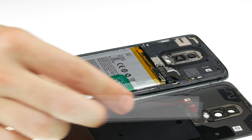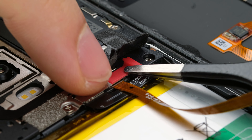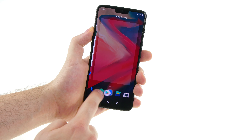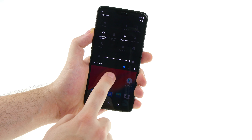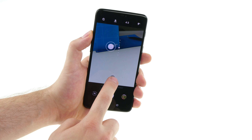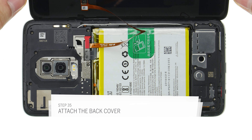Place the back cover next to the device. Position the cable of the fingerprint sensor over its contact on the main board and connect it. Place the cover with the red rubber piece and re-glue the black tape. Before closing the device, you should test it. Turn on the device and check the screen first. Slide an app along the edge and zigzag it across the screen to make sure that the touch screen responds properly at all points. Also test the minimum and maximum brightness. Test the front and rear cameras and the flash. Call someone to test the microphone and earpiece and try the fingerprint sensor. We replaced the broken back cover of our device as well. The instructions for the back cover replacement are linked in the video description.